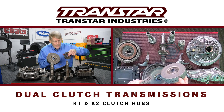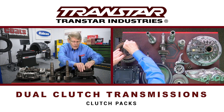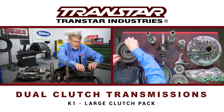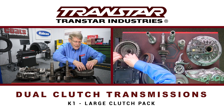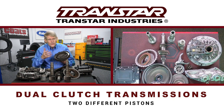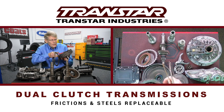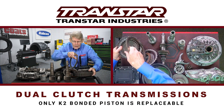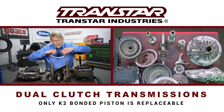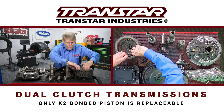What you have inside, in effect, are two different clutch hubs. We call these K1 and K2, and these clutch hubs are driven by two different clutch packs — a small clutch pack, which is K2, and a large clutch pack, which is K1 — and you have two different pistons. This dual clutch assembly is somewhat rebuildable; you can replace the frictions and steels. However, when it comes to the bonded pistons, you can only remove the K2 bonded piston, because the large K1 is captured into the drum by design. If that one happens to be bad, you'll have to buy the entire assembly, which is now available separately.